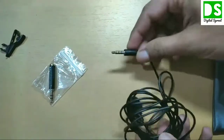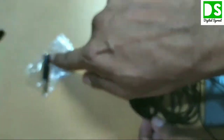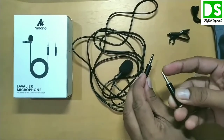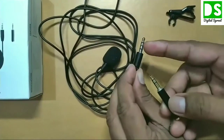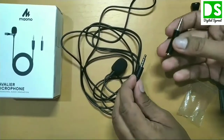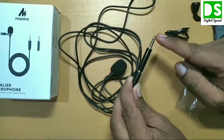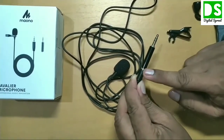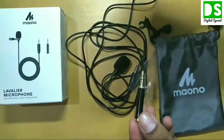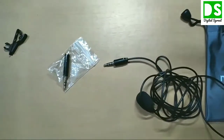Looking at the main body of this microphone, this is the TRRS jack which is compatible with smartphone and laptop, but not directly compatible with desktop or camcorder. That is why this adapter is given — it is a TRRS to TRS converter. In your PC and desktop, TRS ports are available, not TRRS. If you buy this adapter separately online, the price is 349 rupees, so you are getting all these things within just 300 rupees — a definite plus point.